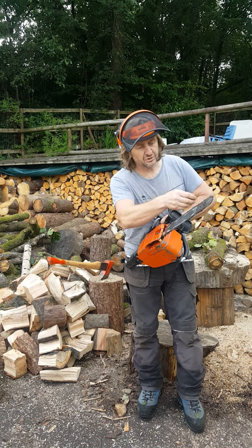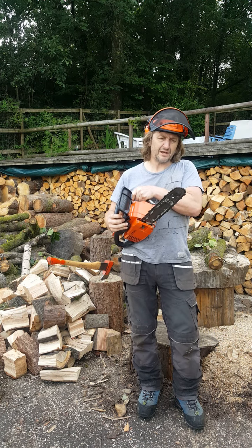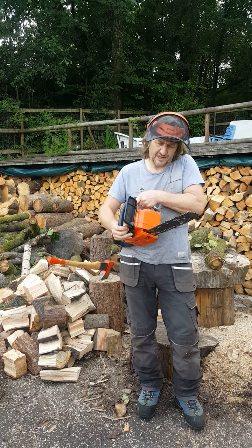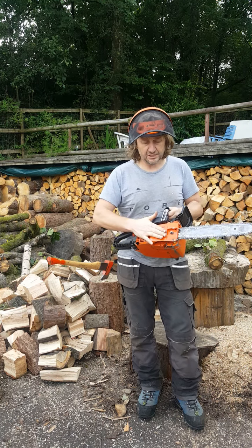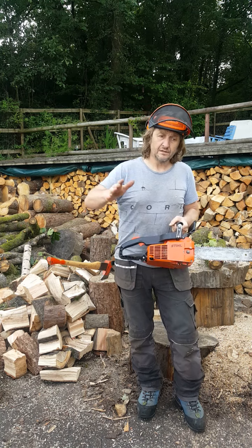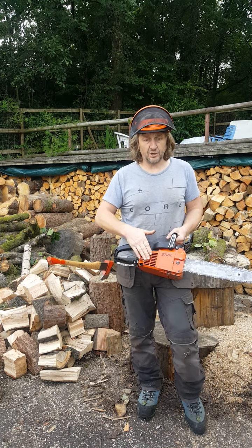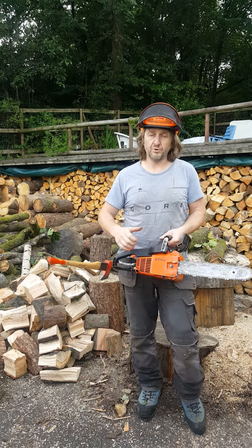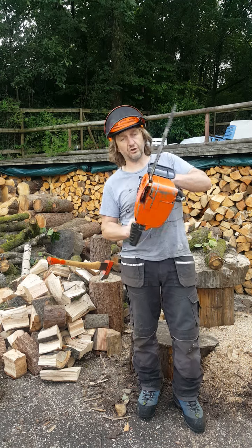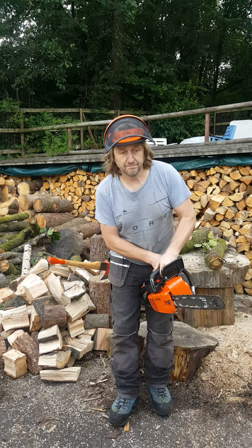It's a genuine Stihl. It's got a couple of tiny chips out of the nose, which I only noticed today because I don't really cut with it. It just hangs up, making up the collection. This is the early orange and black. The next one up from this, the 010, would be in the orange and white, with the AVEQ, the electronic quick stop, with a chain brake. This one just has a spring-loaded hand guard. But a lovely running engine. Bit of choke.